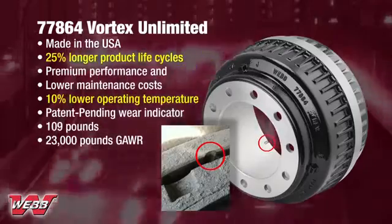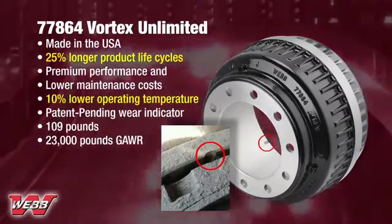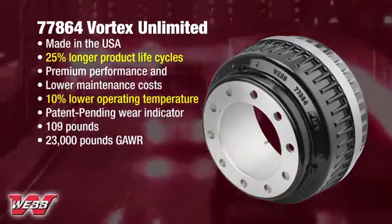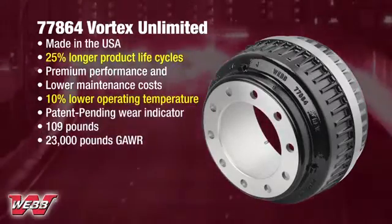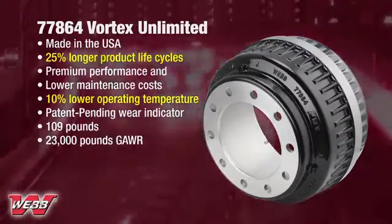This feature allows you to visually and physically determine if the drum has reached its maximum wear diameter, even while the drum is installed. The Webb Vortex Unlimited brake drum is ideally suited for the same applications as the standard 66864, but it runs 10% cooler and lasts 25% longer.